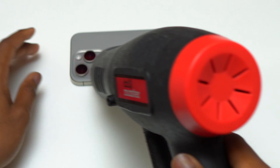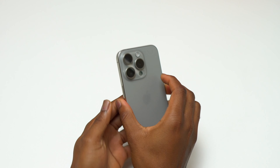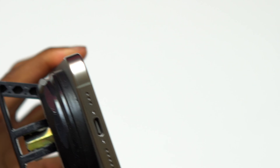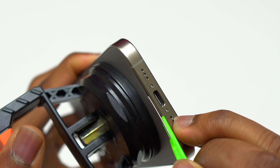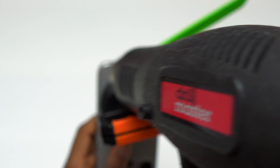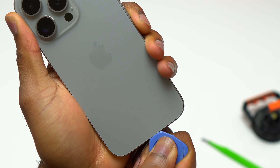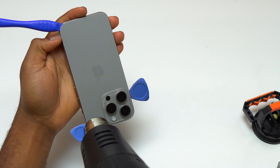The big update with the iPhone 15 Pro and 15 Pro Max is that the back glass is removable and should be fairly easy to replace. I started by heating the back glass for a little more than one minute, then used the suction cup and started to pull on the back. The double-sided tape Apple uses is very strong, so after pulling on the back cover I had to insert my green scalpel. I then continued heating — precisely at the bottom — to detach that portion first, and once I had a small gap I inserted the guitar pick.